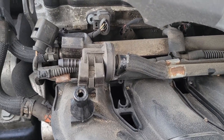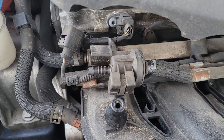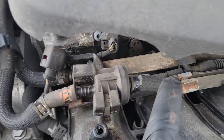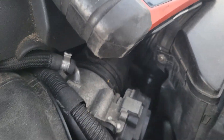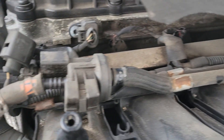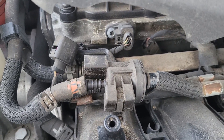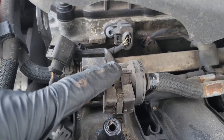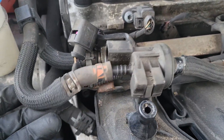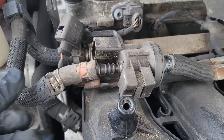That's this guy right here. I've kind of taken it halfway apart doing some testing on it. This line is traditionally hooked up here — this line goes over to the throttle body and you have vacuum on that. Vacuum is applied to the solenoid at all times, and then when the ECU determines it, it's going to cycle this on and off pulse width modulated, pulling in fumes that have accumulated in the EVAP system to be burned in the engine.